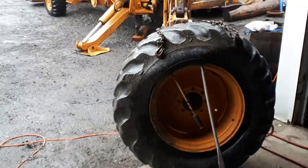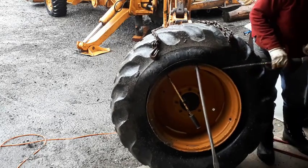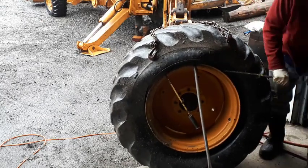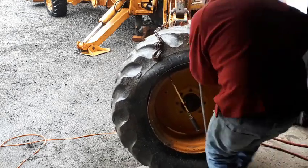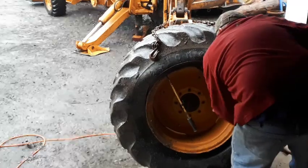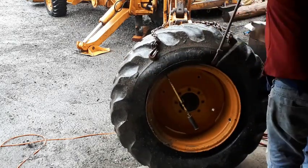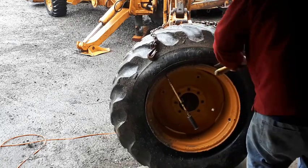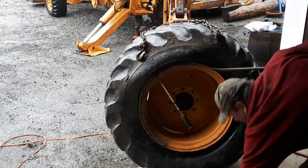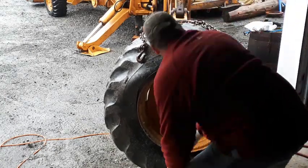It's always going to be spinning on this side if you use it in winter or in mud — you're gonna be stuck constantly. You could probably get by, but I wouldn't recommend it. It's only $500 more, it needs it anyway, this tire's gonna go flat one day. You've got all the tools out, you might as well do the other one. So I'm going to spray WD-40 around the rubber and the metal and my tools as well to get that thing to slip over.